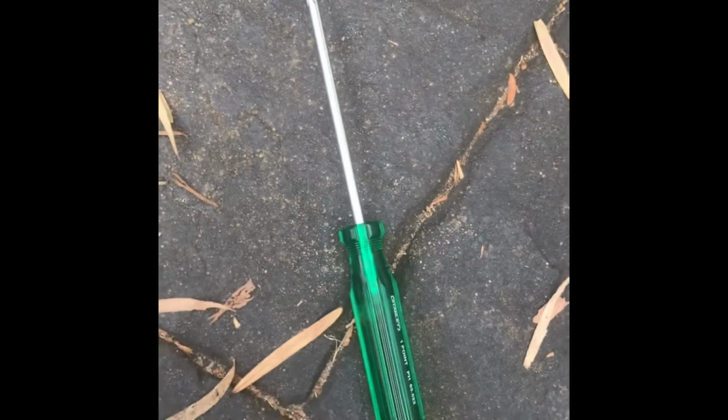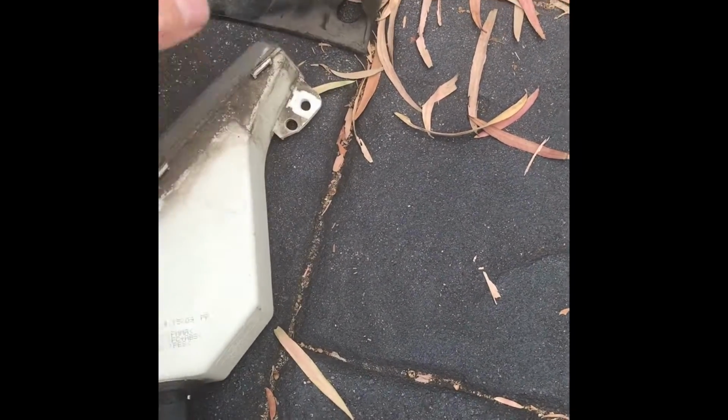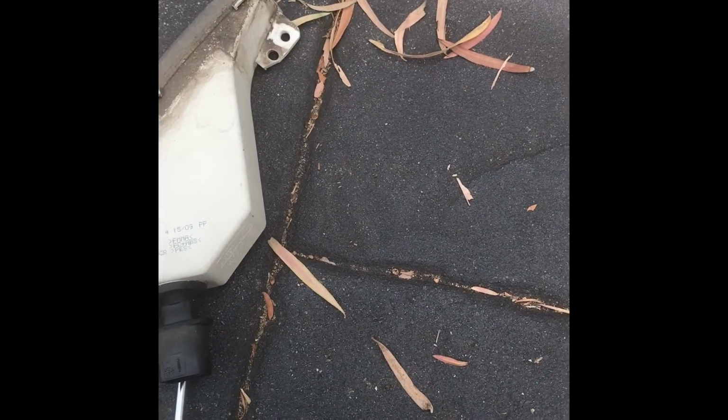Essentially there's a bolt up here, just one screw that you need a Phillips head. This size seemed to be able to get in. Unscrew, comes out, disconnect the loom there, and then quite simply detach the plastic, the housing. Quite easily comes off. Give it a clean, and then the AliExpress DRLs will slot back in and screw in.